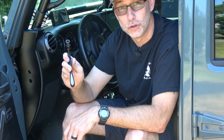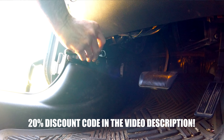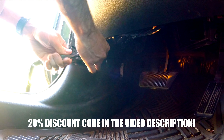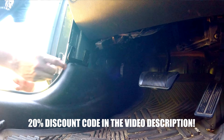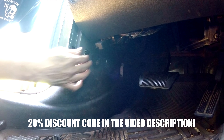So the first thing I'm going to do is just undo this strap and I'm going to undo the wiring. Let my door hang here — let it go gently, otherwise you'll dimple your cowl or something like that. And then I'm going to use the 10 millimeter ratchet to remove these two bolts here. Now it's quite possible after you pull these bolts out that the strap is going to stay in place — that's fine. Just leave it. We're actually going to put the dead pedal over the top of it.